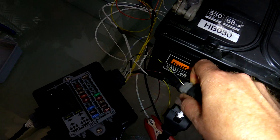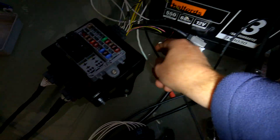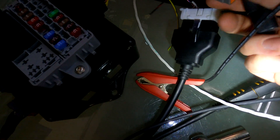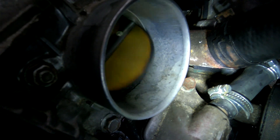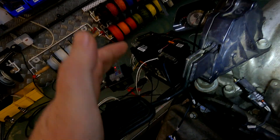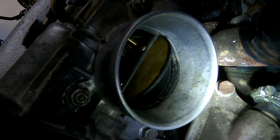So I'm going to take the ignition off, unplug this pedal, and plug in the other one. All right, so now we've got that pedal in — putting the ignition back on. Right, so now as you can hear, this is the enclosed pedal activating it, and you'll see I can go all the way — foot flat — and I can never cause this pedal to go out of sync or exceed its range to cause an error.